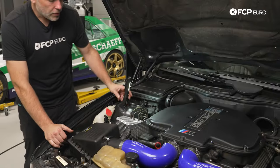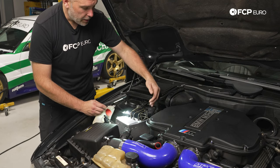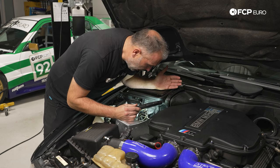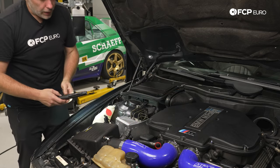No visible leak. If the system's not sealed, that's definitely going to cause a soft brake pedal. But the way this feels — like there's no actual solid stopping point and it feels like you can just keep pressing the pedal — I wouldn't expect that to be a brake line issue or major external leak, because that kind of leak would leave the pedal with almost no force feedback whatsoever. I'm going to lower the car and go to the engine bay. There are two more soft lines to check at the ABS hydraulic unit. Up here, this car has two flex lines that go to the rear hard lines — those were also replaced — and they look good as well, no leakage happening there.